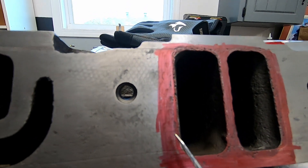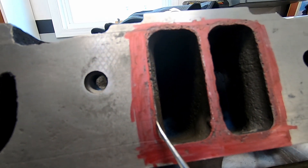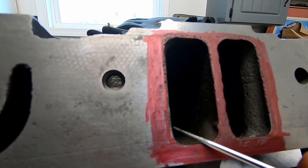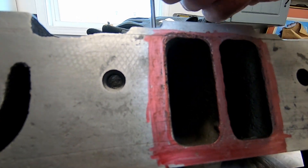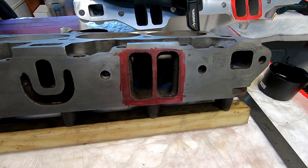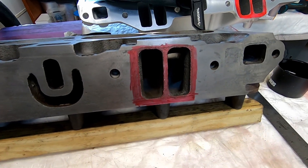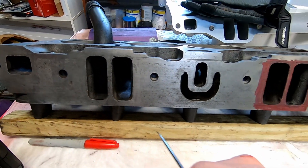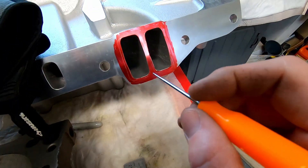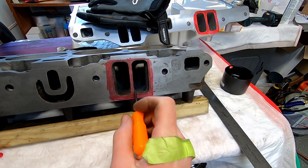If you can see our faint line goes all the way out to here. I don't really see a necessity to grind this all the way out where the pushrod pinch will be directly inside of that. There's no way in the world I could bring the pinch out to here without somehow sleeving or tubing the pushrod holes. So I'm not doing all that — that's like next level Steve Dulcich stuff. I'm trying to give it a nice, clean, simple port job. I will actually have to match the intake to the head port, even though I'm not really opening them up very much.